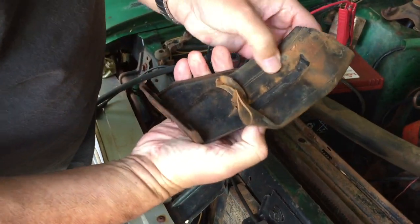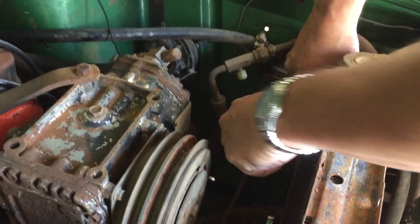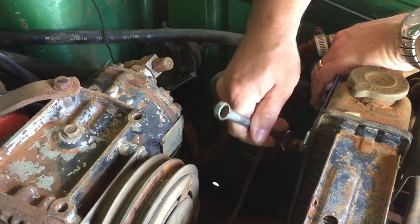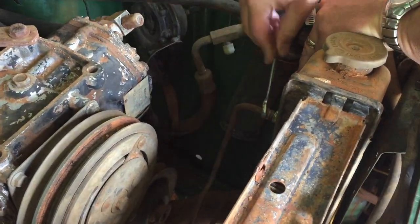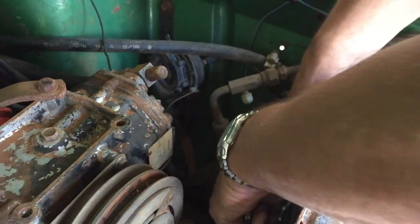Look at that - rubber inner tube, there's a bush for the radiator. Bush ingenuity. Automatic transmission - there's a lot of lines off the radiator here, sort of a two-part thing. Hopefully automatic transmission fluid doesn't just leak out of them. The bottom one leaks - we've got carnage! Actually that's the transmission fluid and it looks nice and bright and red, so that's good.